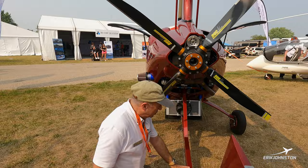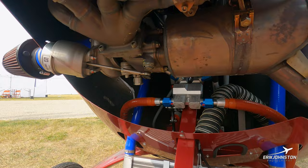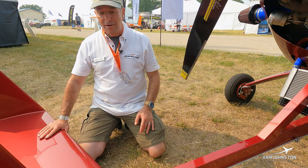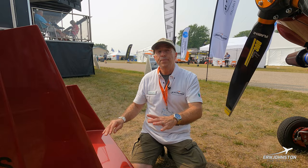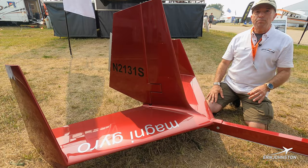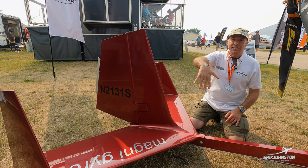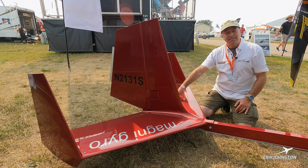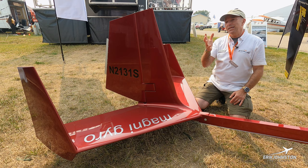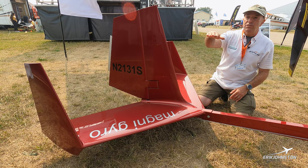Coming back, you can see the 4130 chromoly steel keel going back and up top, and you can see the tail. One of the big differences from old gyrocopters — the Bensons and related designs — is that the tail on those was much closer to the engine and much smaller, so it didn't have nearly the stabilizing effect of this big tail. One problem of the old gyroplanes was called pilot-induced oscillation, or PIO, or porpoising — the gyroplane would start to pitch and you'd try to correct, getting into an oscillating motion because there was no tail to stabilize it. This tail works very similarly to the fins on a dart: those fins keep it nice, level, and straight heading to the dartboard. The tail does the exact same thing for a gyroplane — it keeps it straight, level, and flat, preventing porpoising.